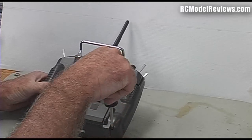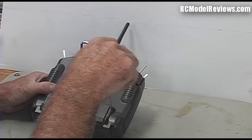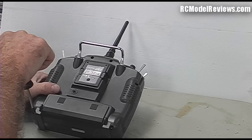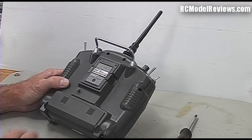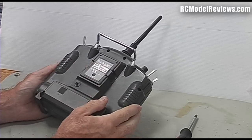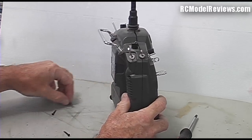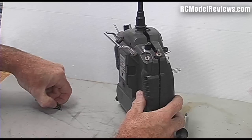Now we can use our Phillips head screwdriver to undo the screws. There are two at the bottom and sometimes these are done up pretty tight. The posts that the screws go into can be broken due to the amount of force used during assembly. By this stage your hands will be tired from all that unscrewing but the back should simply come free. We'll leave the module in for now. We're going to stand it up and tip it over so all the screws fall out - otherwise they'll fall on the floor later and we'll lose them.